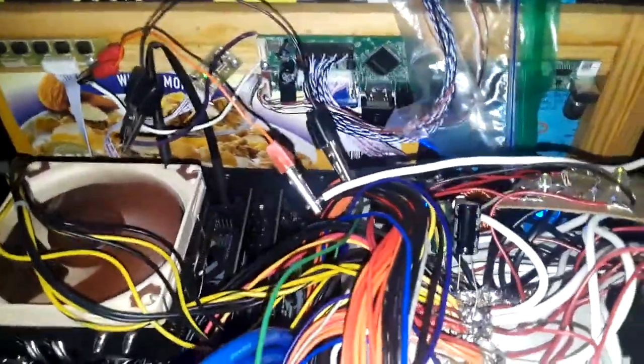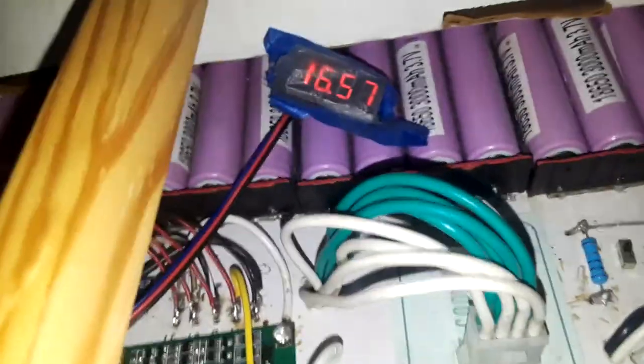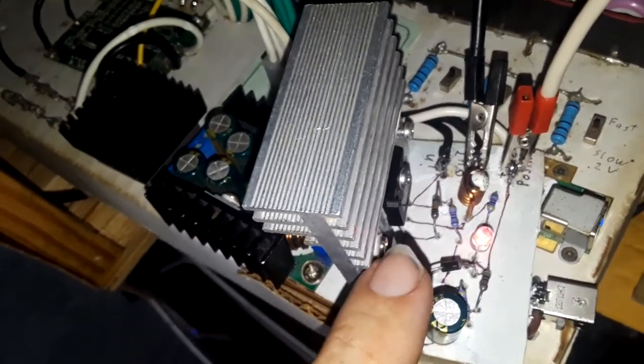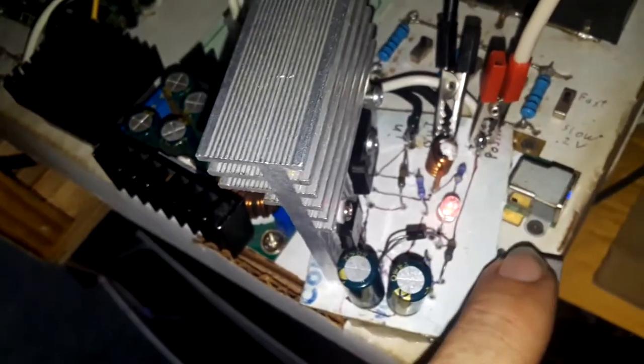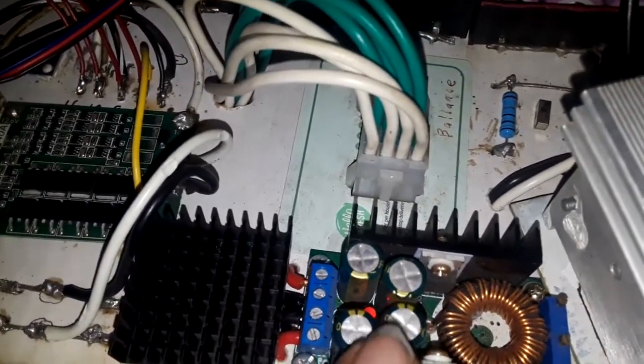Here's a little video of this laptop I'm building using a desktop motherboard. Still a work in progress getting it set up, testing, and fixing bugs. Here we've got the battery — 16 batteries, 16.57 volts. Power goes in through here. This here is to prevent inrush so I don't use a lot of power when hooking up a power cable — it doesn't make a spark. It creates a delay and then goes into the first power, though this is probably not going to be enough and I'll have to use a more powerful one. But for low use it's okay.